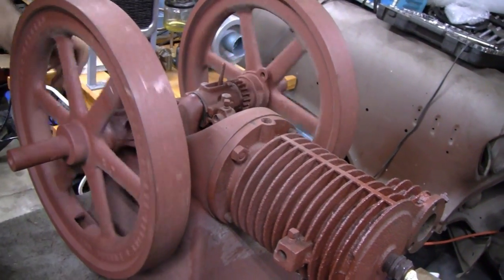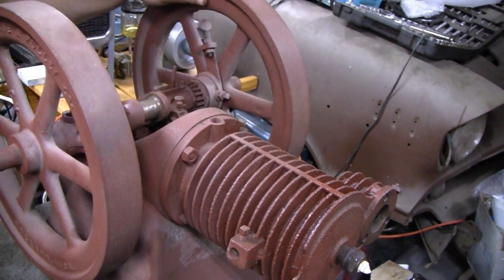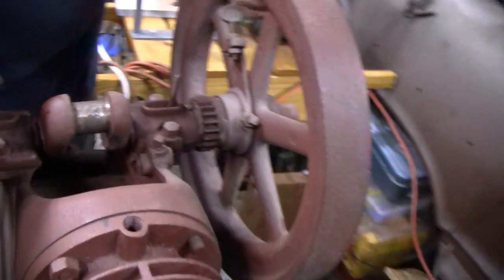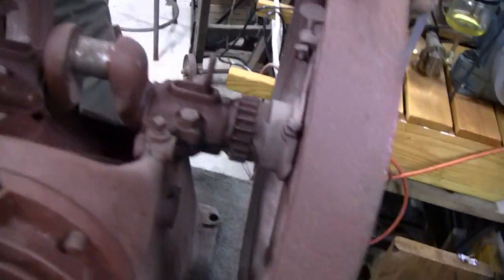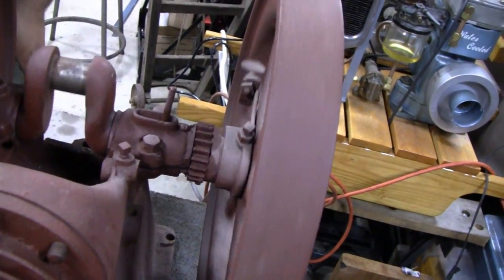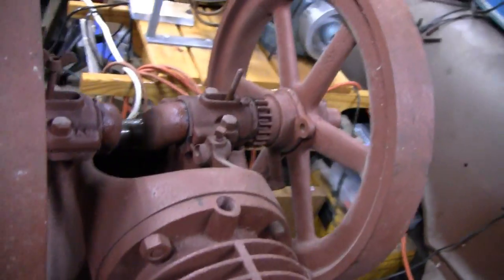We've got the flywheels and the crankshaft together, and the bearings, the Babbitt bearings, are in their carriers. They're loose. It was just loosely assembled mostly, so it didn't lose everything. Even the cap is just sitting on there. But it runs smooth, you know what I mean? Yeah, the Babbitt's probably in good shape. It probably just needs to be reshimmed, so it'll be fine. No problem there.